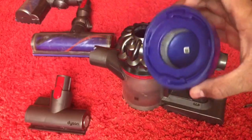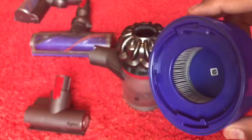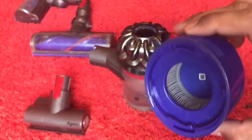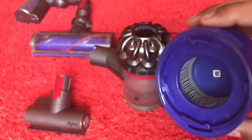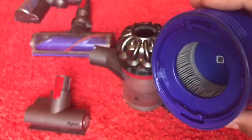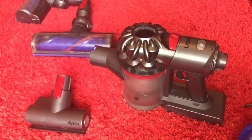This filter might need to be replaced because since it's a HEPA filter, the ultra-fine pores do get clogged up with water unfortunately, unless it's properly dry and you keep up with the maintenance. But if the filter is really bad and dusty, it's quite difficult to clean, so you might be better off replacing this filter to make the performance like new.